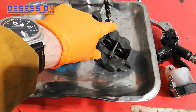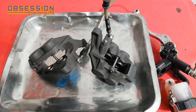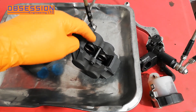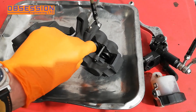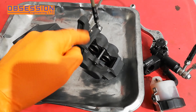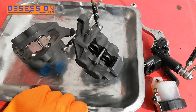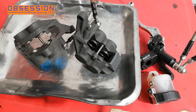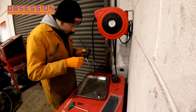To do that, I'm going to take the brake line off here, split it off so the caliper is free. Then I tend to put the airline on it and gently, a little bit of air at a time, until the pistons move. What I also tend to do is put a cable tie round three of the pistons, pop one out at a time, replace the seals, put a bit of red rubber grease on everything, slide the piston back in, cable tie that one, move on to the next one, and move around the caliper until they're all done. I've previously done a whole video on cleaning brake calipers, so if you've got insomnia, it's an excellent cure.